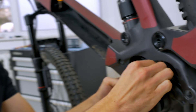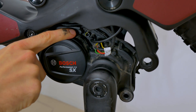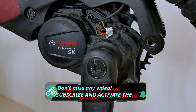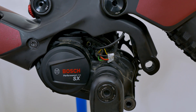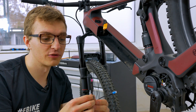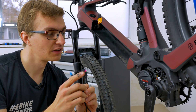And then, with the new SX motor, we now have only one other connection directly on the motor, and this is a very special connection. There is currently a dummy plug fitted in because it is not used on this bike. This is marked yellow, normally for the HPP high power port, and grey, usually for the speed sensor. This is now called MPP — the multi-power port — and various things can be connected to it at the same time. This is made possible by this interesting cable, which looks a bit like a spider, and in the end it works like one. This is the MPP multi-power port cable, which has a purple plug that can be plugged into this multi-power port.